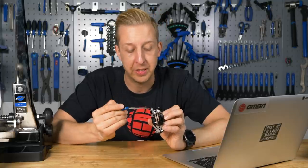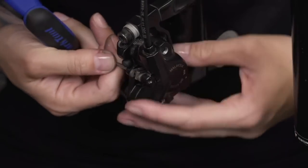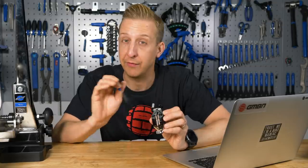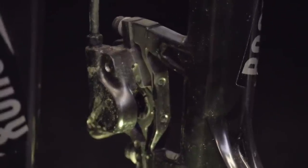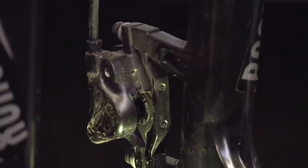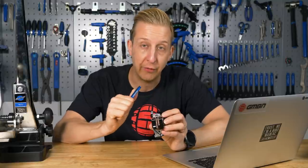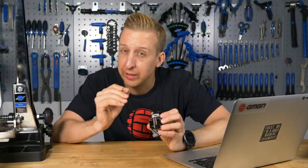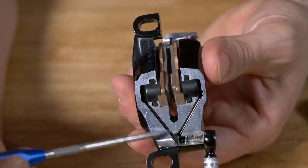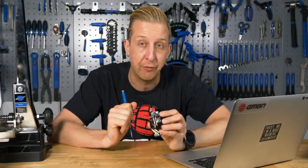The O-rings are what allows the piston to slide through, and also what pulls them back into place again, so they're quite important bits to make sure are lubricated correctly. Now if you found that your pistons aren't moving correctly, most of the time it could be cured quite easily. Be very careful - you don't want them to completely touch, because at that point they'll nearly be out of the caliper itself, and they're susceptible to getting air underneath them, even if oil doesn't leak out.